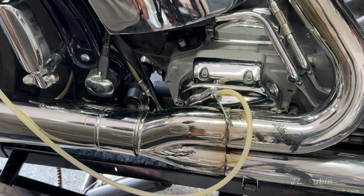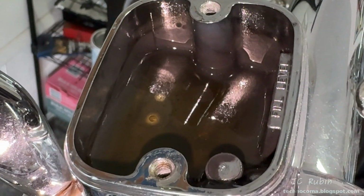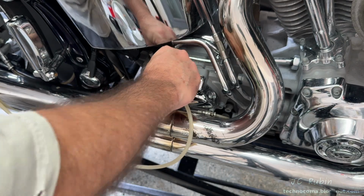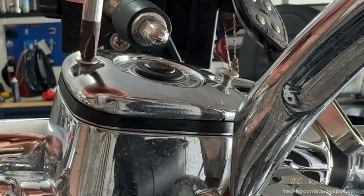This bleeder is a lot smaller, so it does take a bit longer to do the job. Also, not knowing how big the slave cylinder is, I just run a couple cycles through, which I've sped up here so you can see it drain. Pull through about 3 reservoirs of oil, and I close it off. Drop the hose, top it off, recap it, and lock it down.